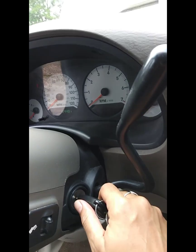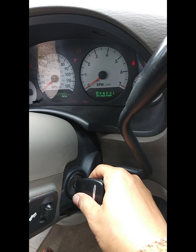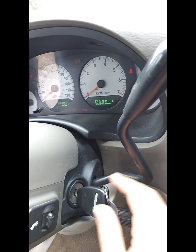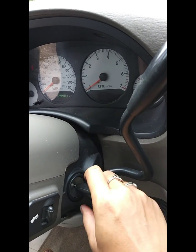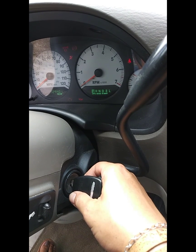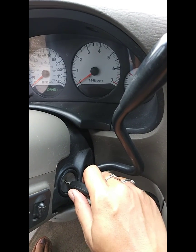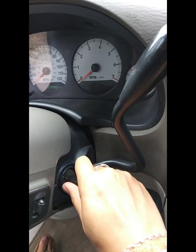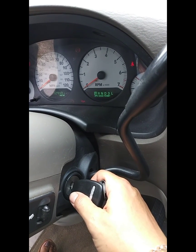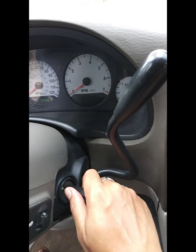Alright, we're going to get back in the car, not start it, but cycle it on. Wait about 10 seconds. Shut it off. Power it back on. Wait about 10 seconds. Shut it off. Power it back on. Alright, now let's give it a start.